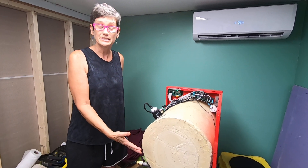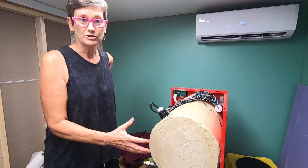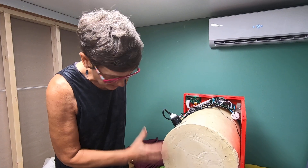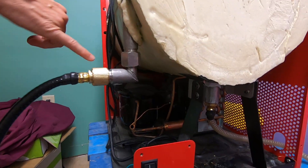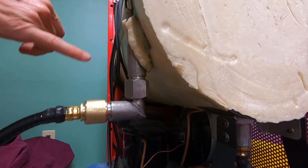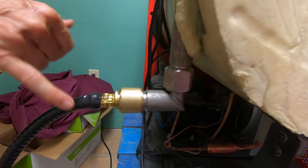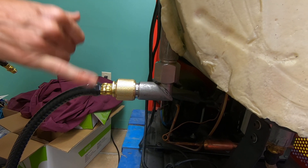We've learned how to take apart our freeze dryer, which is still taken apart. When you have a leak, there are a bunch of places to check. You have this elbow here for the vacuum hose that comes up into the drum — there's an o-ring inside this elbow, so we had to take that apart and replace the o-ring. You also have the actual vacuum hose, which is only supposed to be hand-tight. There are o-rings in there too, but also these crimps, and we got self-fusing silicone tape to help reduce any problems there.